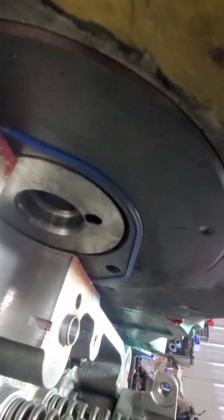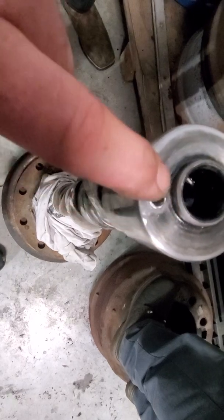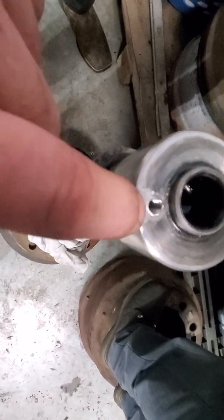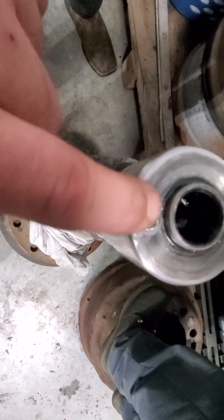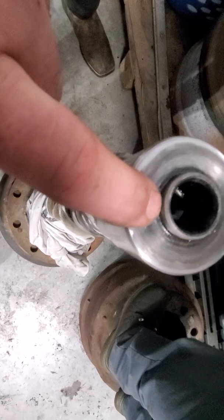That little divot — can you see that? I don't know if you can see that. Anyway, I found one of America's best mechanics, Jesus and his son Orlando. What I did was, I smushed the dowel pin because, as I showed you guys in a previous video, the dowel pin has to line up into that hole in your thrust plate. I almost tossed this camshaft across the shop.